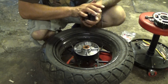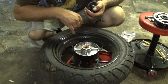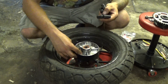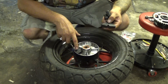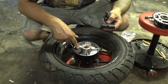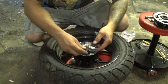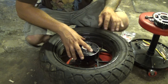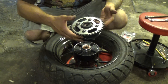Pull all those old dampers out. While I'm in here, I'm going to make sure this bearing is good — it does look perfectly fine. Now I've got my new bushings and I'm going to simply slide them into their spots, with the piece of rubber joining them bridging across the section of your hub. Just snugly press them right in. After they're all in, put your sprocket back on.